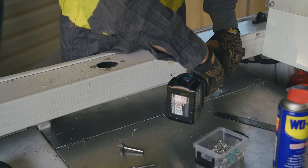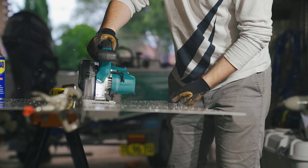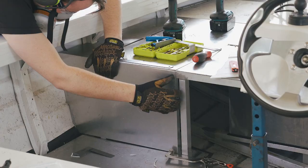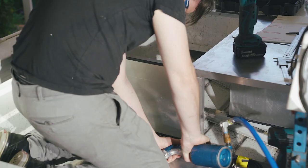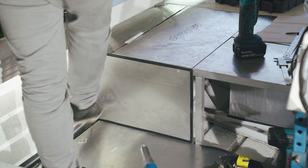When I cut the EVA foam, I will need to leave some small holes to access these fasteners. Now that all the top surfaces are secured, I needed to skin the vertical faces with a kick panel. I purchased a half sheet of 1.5mm ally as this wasn't a structural wall. I decided to cut them into separate sections so the modules could all be removed if the need arose, kick panel included. The panels were riveted into place with countersunk aluminium rivets. I had planned on using pinch weld around all of the edges, but with the COVID outbreak, pinch weld ended up being quite challenging to find as it's used extensively on point of sale shields.